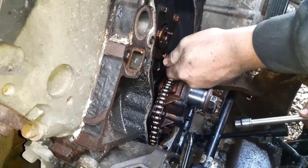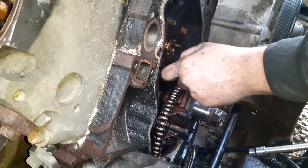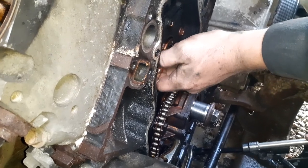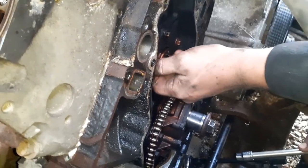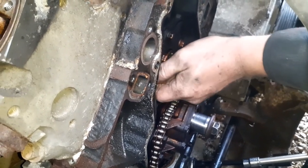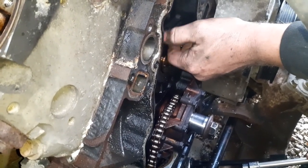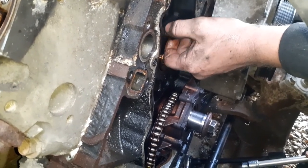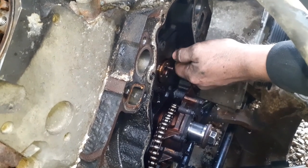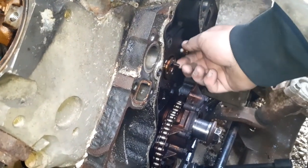Which would probably be a good idea to do - on small block Chevys that's a good thing to do anytime you're in here. But there's something about these LS motors where you don't want to fool with the oil pump too much - the seals and stuff. Anyway, we're taking the cam retainer plate off now. Then what we're going to do is stick the water pump bolts into the cam, take the push rods out, and spin that cam real fast - not slow, real fast - so it pushes them lifters up real hard.